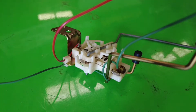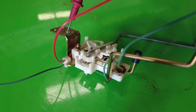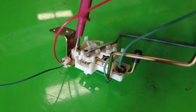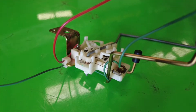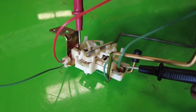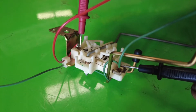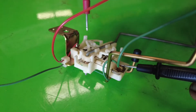Here we have the factory level sending unit. When you mount it to the fuel sending unit it mounts through a screw hole right here, and that is also where the ground cable goes. This bracket transfers the ground signal to this screw. To verify if it's functioning, you check continuity between this point and this point right here, and as you sweep this arm up and down you're going to see the continuity change — it'll give you a sweep from no resistance to full resistance.